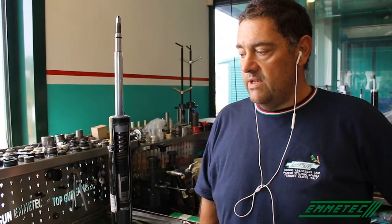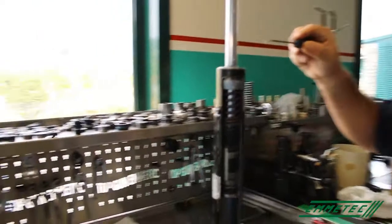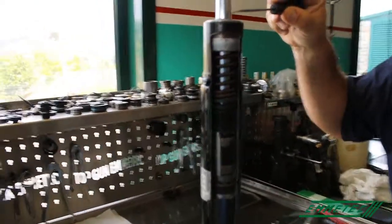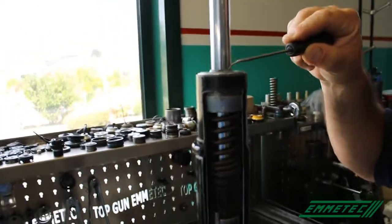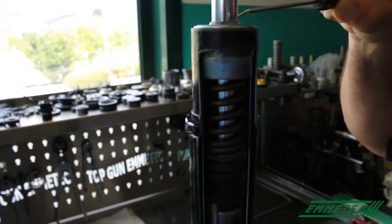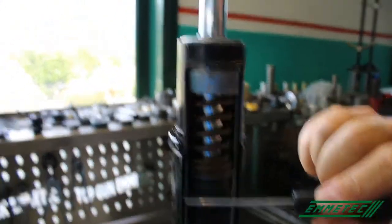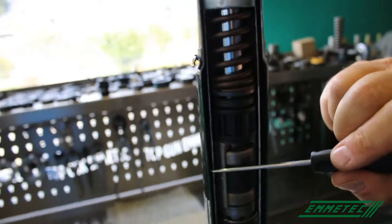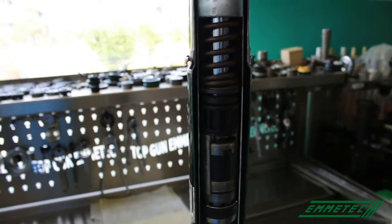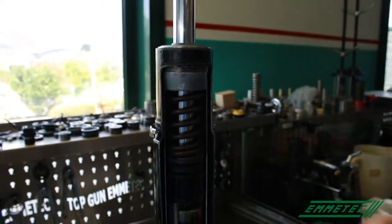It happens very often that twin tube shock absorbers are pressurized. Pressurized means that during the manufacturing or remanufacturing, some nitrogen is introduced into the shock absorber and remains between the guide and the oil in the chamber. The gas has many effects.